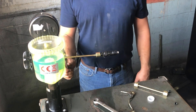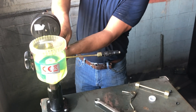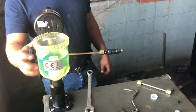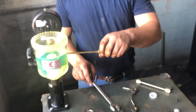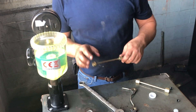I will say that the mist or spray coming out of the new injector was considerably finer than the spray pattern that came out of the old fuel injector. With the higher pop-off pressure you're going to have better atomization, and with the nozzle being clean on the injectors you're just going to have a better spray pattern.